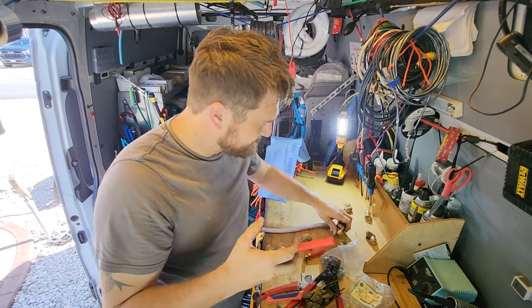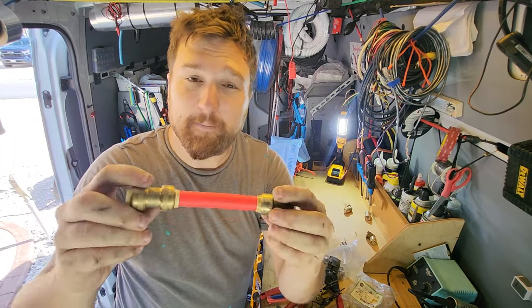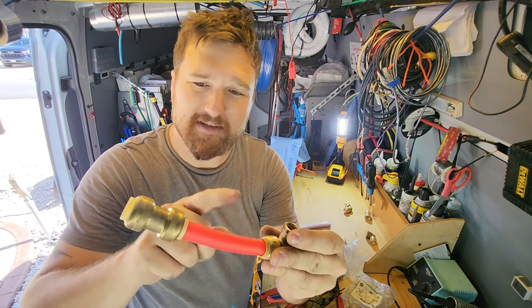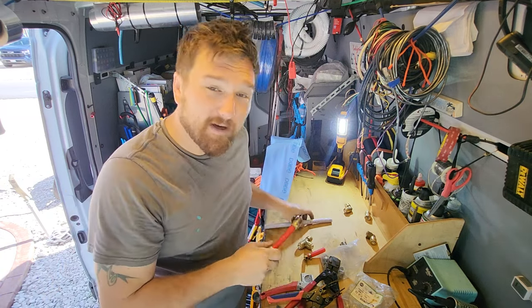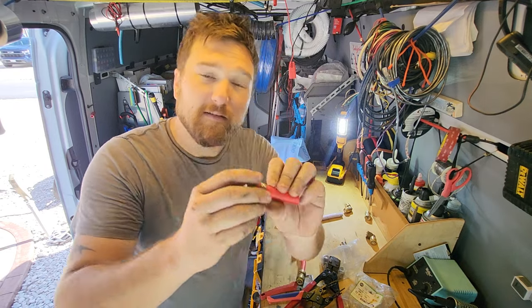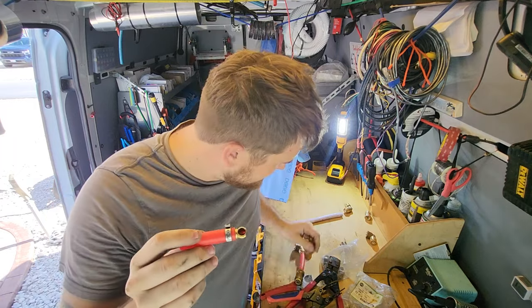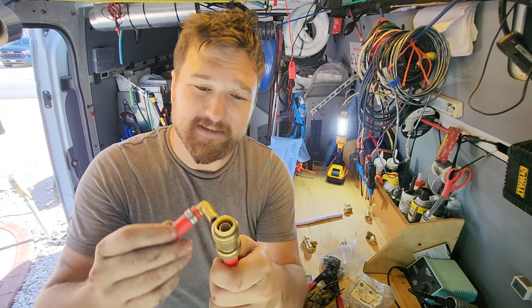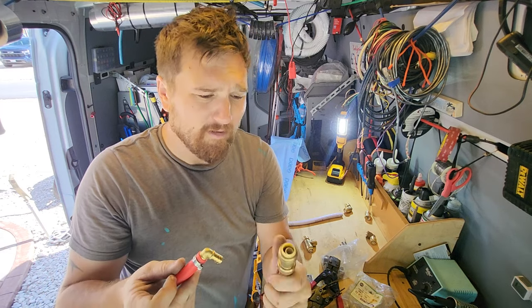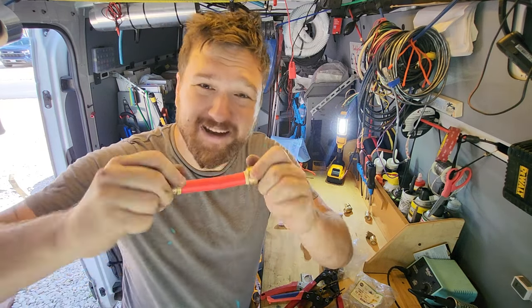It's super easy to design anything you need. I'm going to put links in the description about each of these pieces so you can buy your own if you need to. Anytime I work on my RV and I find one of these bow tie fittings, I make sure to cut it out and reinstall with SharkBites because these things are great. And again, reusable. They're proven. These can shake and bounce down the road and they're not going to get loose.